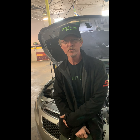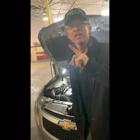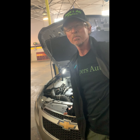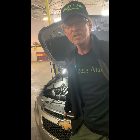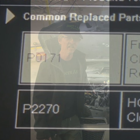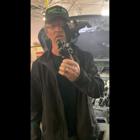Hey guys, Tim Cooper. Got this 2012 Chevy Cruze in here. This particular one doesn't have the code in it, but we have another one in the back that does — the P0171 main code. There's also another code, I think it's a P02-something. Anyway, it's very common: the valve cover leaks inside on the PCV system and you have to replace it with a new upgraded valve cover. This one's leaking oil but hasn't been replaced, and it had a coolant leak on this housing right here.